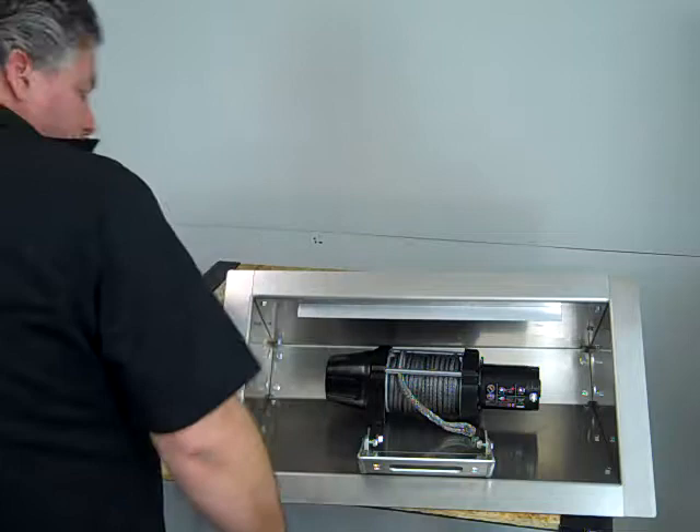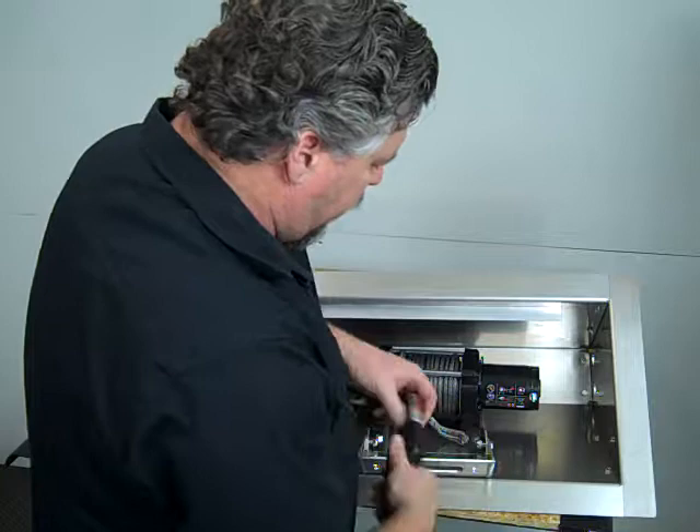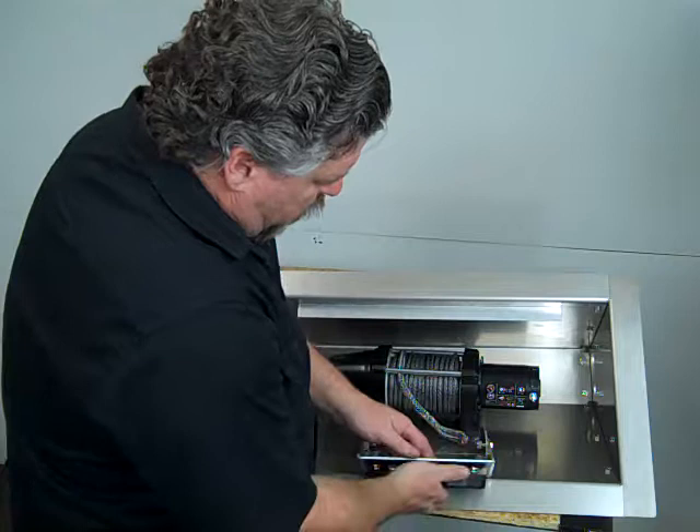With that in place, the next thing you'll do is put your fair lead on. For the rope, it uses a smooth fair lead like this. For the cable, it'll have the roller fair lead, which bolts on there also. You can put the fair lead on the inside or the outside of the fair lead holder, and then your rope will run through and your hook will be on there.